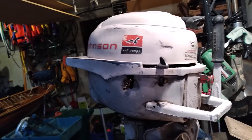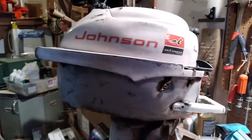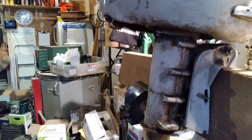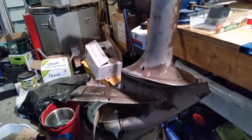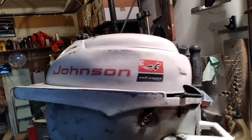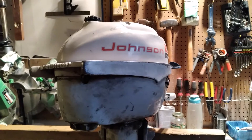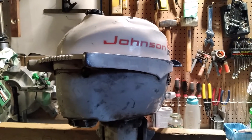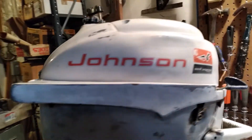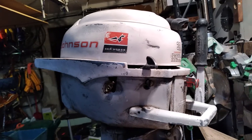This is a three horsepower Johnson 1964 JW-19M. It's been sitting in someone's basement for about 30 years — one owner, and after the owner passed away, the son put it in his own heated basement and left it there for 30 years until he had to move. I've picked it up and haven't taken anything apart. The grease is all gummed up and won't swivel, there's about a quarter inch of varnished gasoline in the tank, and the carburetor is probably in the same condition. All the parts seem to be here, so this is going to be a complete tear down and rebuild.